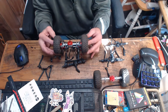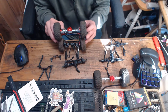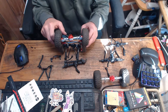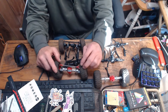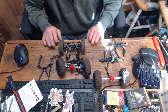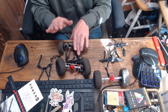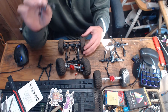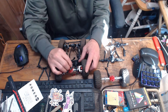You can see that it's not going to extend your wheelbase that much. You're pretty much going to get about a quarter of an inch, so a half inch total extended distance, which is nice for your tire clearance. That pretty much is going to wrap up this video. This is something you're really going to need to know. I hope I didn't get to you too late — where you end up like I do, having to order shock mounts for my axles because the shock mounts that I have won't fit.